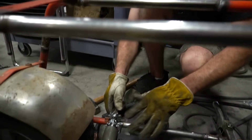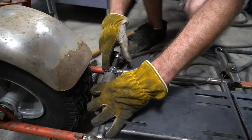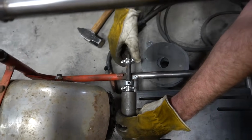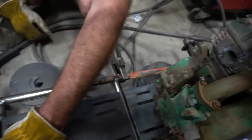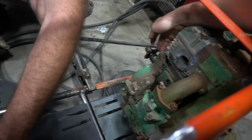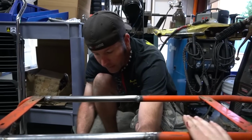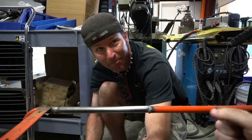We're going to put the jack shaft either in the middle or the back here. And this sprocket's going to go to the drive sprocket, and this sprocket right here is going to go to the clutch of the engine. Sounds good. Yep. And the clutch is going on the end of the black one right here. And then we're gonna have the sprocket here. Welded, right? Welded, tying these two ends together. Yep. So you got to start both of them at the same time. Yes. Because they won't run without the other. Right. Yep. I love it.